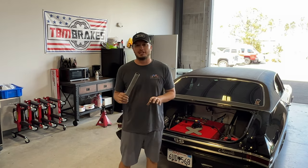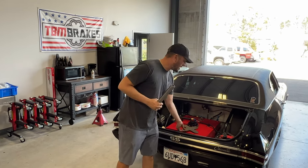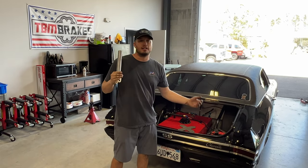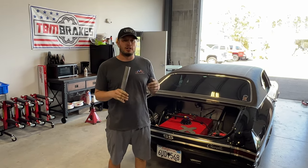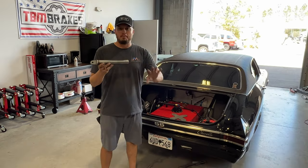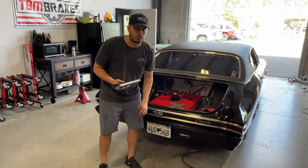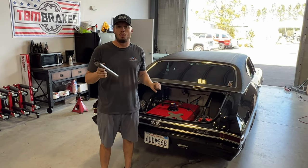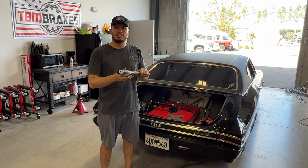This one's inspired by our sick week prep here on Tanner's 68 Chevelle. We're putting a parachute mount on this thing, and we are using our DIY kit, which comes with all the bends and pieces you need. This is something that's not super considered half the time or a lot of the time, so I figured I'd share it with you guys. Basically, once you have your mount on your car, we use a slip-fit inch and three-quarter tube with our DIY kit, and then this inch and a half bar slides inside of it.